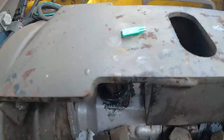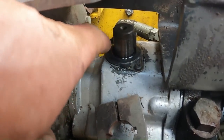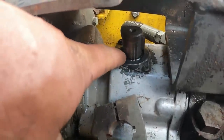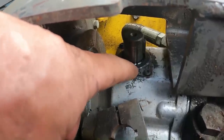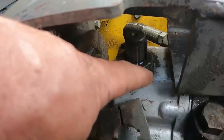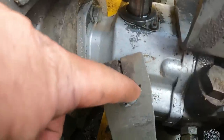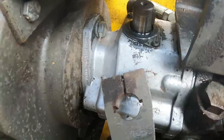Let's get the camera down in here. There's a shaft coming up out of this, and a piece that goes over the shaft for your steering — it turns the valve in there. That's the seal that's leaking. I'm not sure if it's a special seal or an O-ring, but it's got a little tin cover with a couple of Torx head screws on there. I'm going to pull those out and lift that cover off. There's a key in here too — the key lines up in grooves when you put it back on.